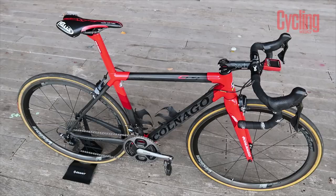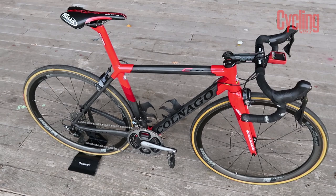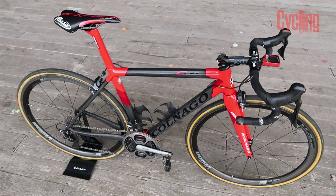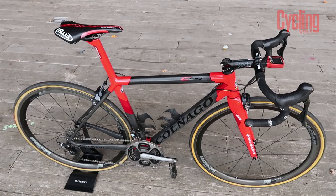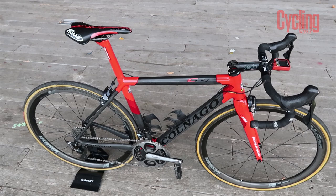So now we have four key bike measurements. We have saddle height, like we've already talked about, and we have saddle setback. This is really important because it positions you over the pedals correctly — the longer limbed you are, the more setback you're going to have. Me being quite short, I have quite a shallow setback at only 5cm. The other two important measurements are the tip of your saddle to the centre of your stem and the tip of your saddle to the end of your shifter — that's 55cm to the stem and 68.5cm to the end of the shifter for me.